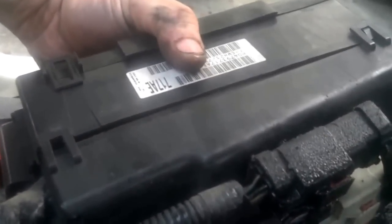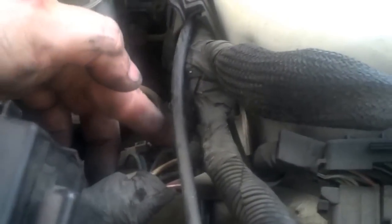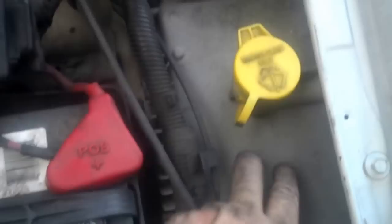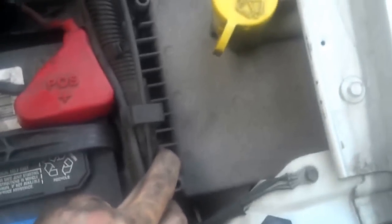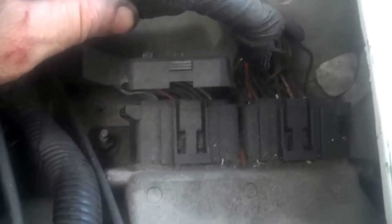Notice there's no oil above the connector on the fuse block — the fuse block sits in this orientation with no oil from above it, but the connector is absolutely soaked through. Even the back side where the wiring enters the connector is saturated. I haven't opened that connector yet. Now, the wiring comes around down and along the loom against the strut tower — and that right there is my main ECU, the engine control unit, which lives under the fender in the left front. Notice the condition of that connector: soaked with oil.